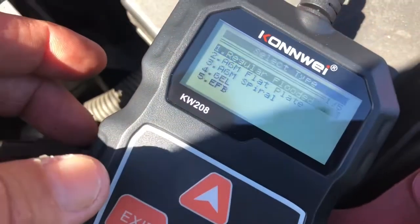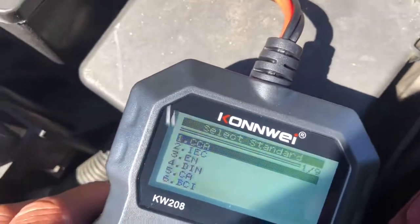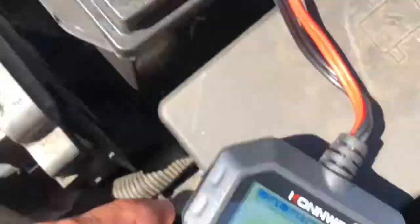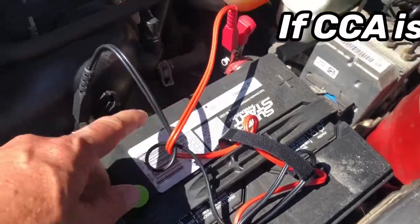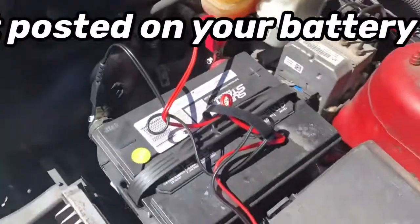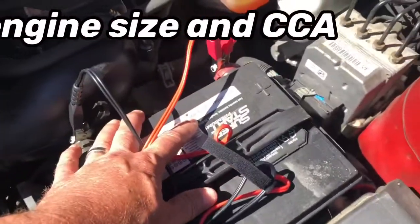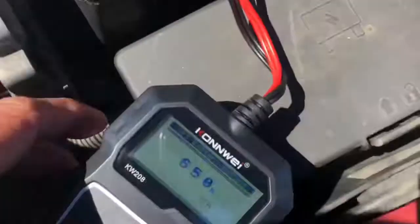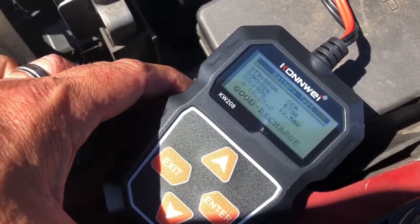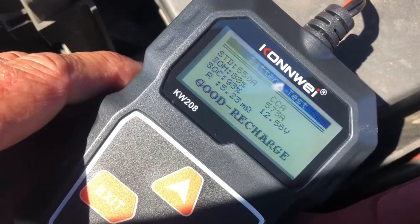It's not a flat plate, spiral, or gel battery — those batteries are expensive. Anyway, it asks for your cold cranking amps. 650 are usually listed right on the battery. If they're not, I've Googled it before. At the shop you can Google your 3.9 V6, whether it's a four, six, or eight cylinder — that will give you your cold cranking number. So if you don't have your CCA number, that's what you do. Testing... It says the battery is good but needs a recharge. The G6 has been sitting for a while, but the battery's still good.